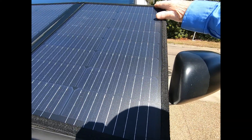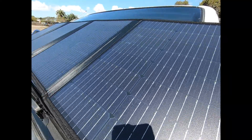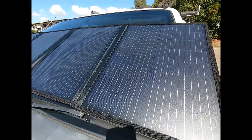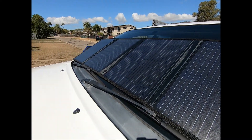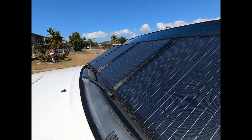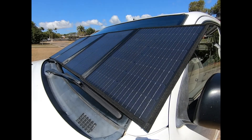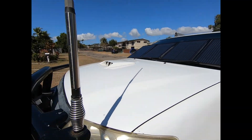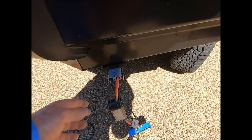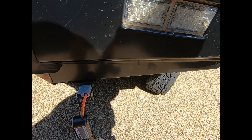That's the finish — looks quite good. Bypass diodes, four-panel, fits perfectly on the windscreen. You don't want it on the paint — putting it on the paint could damage it. But that's how I've got it on the ute. It charges through this Anderson plug adapter, through a fuse up to the secondary battery. The secondary battery is also charged by the alternator.